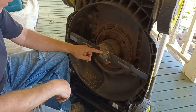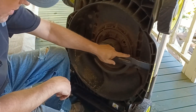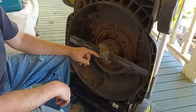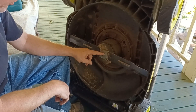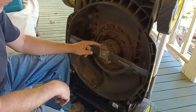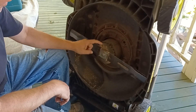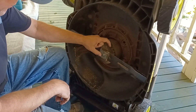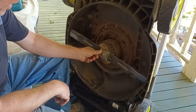What we've got here is a set of blades — two blades — and I'm taking them off to grind them down because they're just beat to hell. We have a rocky yard, so we get some rocks flying around. What I'm going to do is take off the nut from the threaded bolt that's permanently mounted to the unit, and then take off the plate and the Teflon — hard plastic Teflon — in between the blades and the lockdown plate.